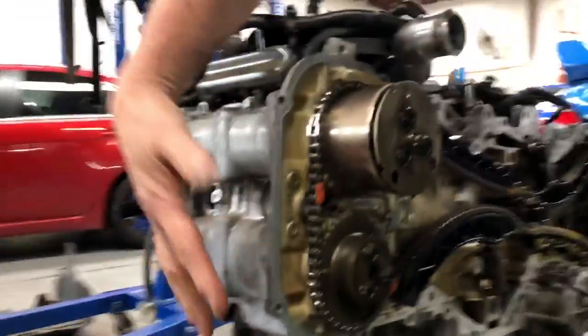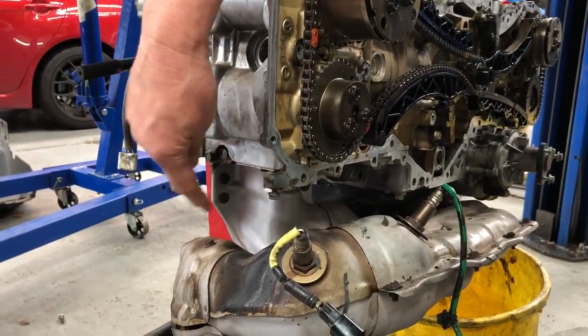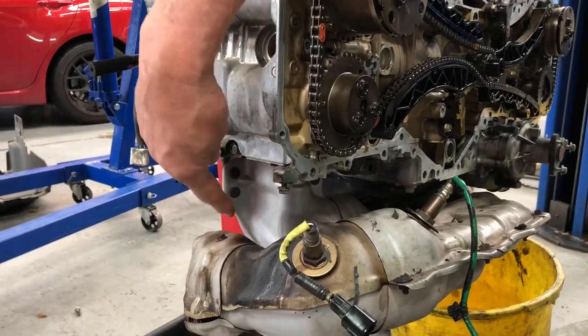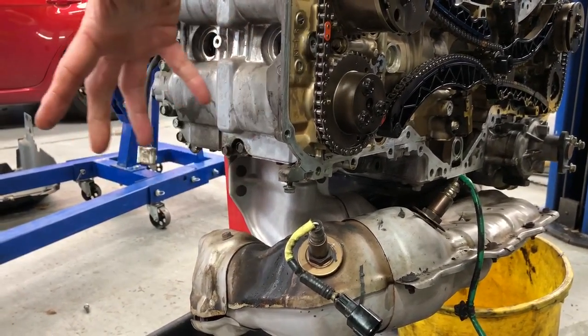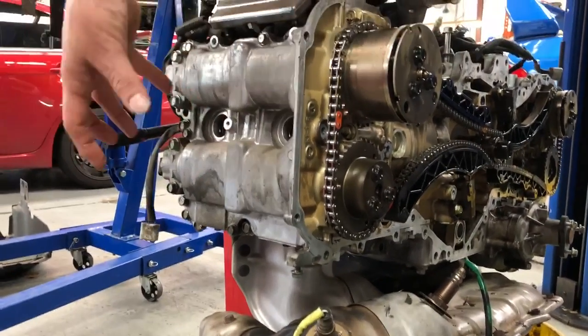You can see around the side here — we haven't pulled it off yet — and you can see where the oil has been leaking over the exhaust manifold, which is what the client wants to fix, because he hates that smoky smell whenever he runs the car. The exhaust manifold gets hot and it burns the oil off and creates a horrible smell inside his car. To fix the oil leaks on these engines, you've got to pull the rocker cover off first.